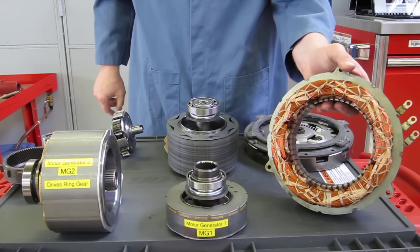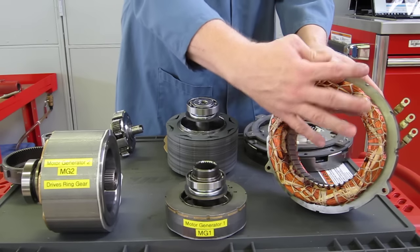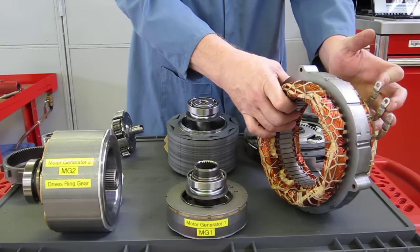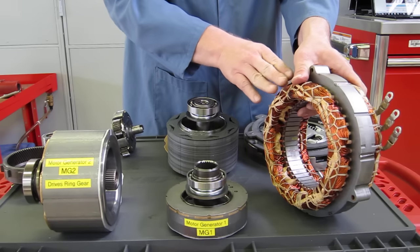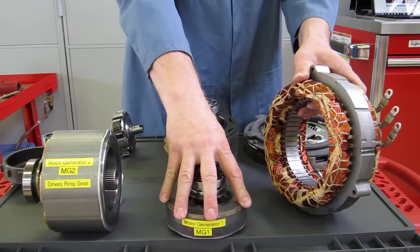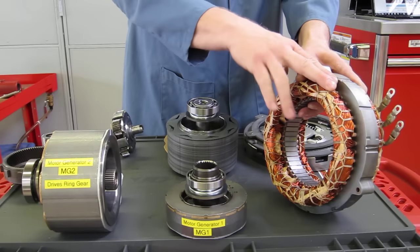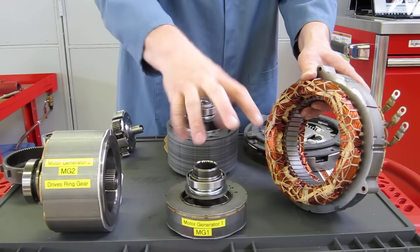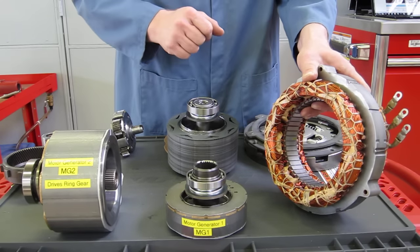This is very much like an alternator of any other vehicle. This would be the rotor spinning inside of the stator, and it would generate three-phase AC power that goes to the rectifier, is changed to DC, and charges the high voltage battery. This acts just like that when spinning powered by the engine, but it can also be reversed — we apply three-phase power to the stator windings and force MG1 to rotate.